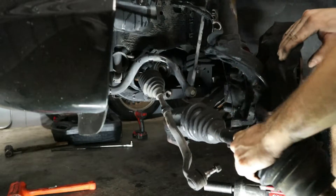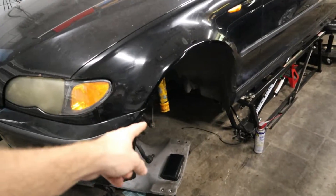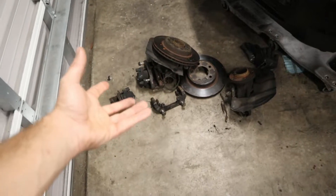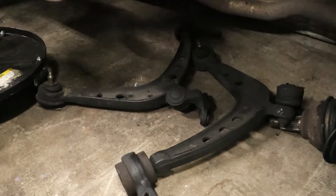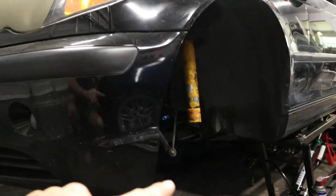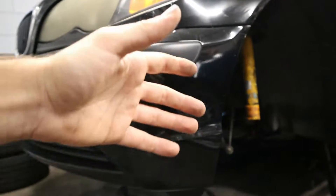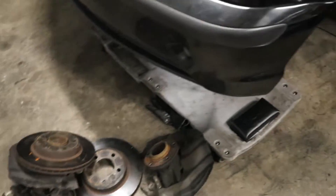Let's pick up where we left off with removing the front axles. If you didn't see my previous episode, we removed the front axle shafts. Right after that I removed the 18 millimeter bolts holding the struts to the spindles and the spindles came right down. I also removed the 21 millimeter bolt holding the control arm. The axles are back there and up here we have the brake rotors, front spindle assemblies, and calipers. You need to remove the axles to remove the oil pan because the axles sit in the middle of the oil pan.